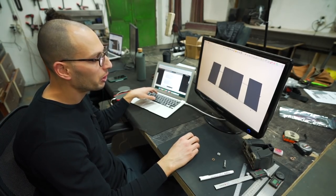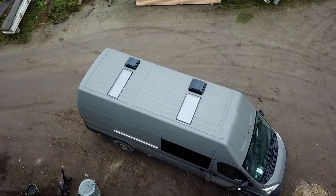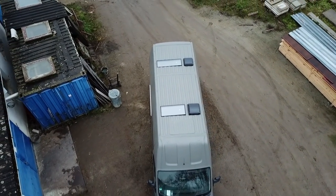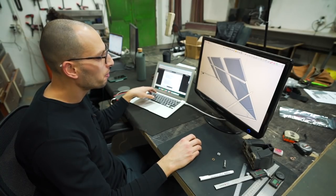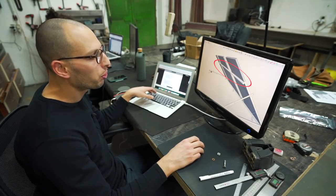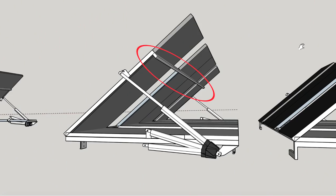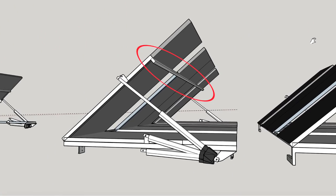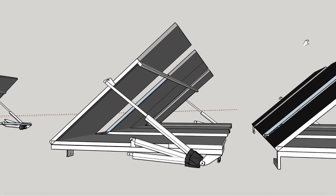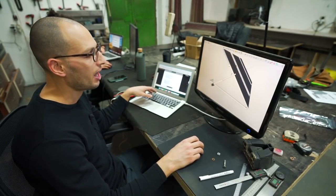You're probably familiar with the roof layout. We already have these cutouts of windows. Here is where the vent is supposed to be, and here is the triple glazed window we already have on the roof. I decided to make one beam along the entire length of the roof to support those solars, and I'm purposely ending it here, not all the way at the end of the solar length, because I would be creating more lever on those actuators. In a really low position where it's folded down, that would be difficult to overcome with that heavy lever.